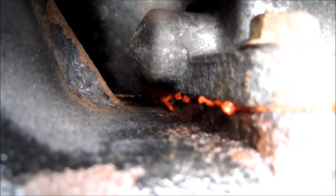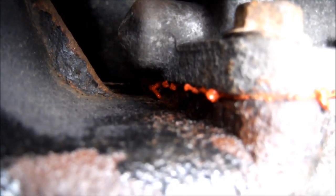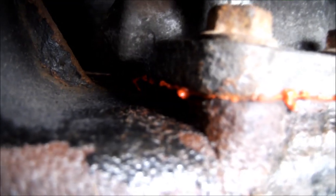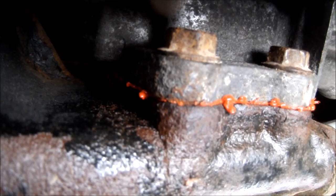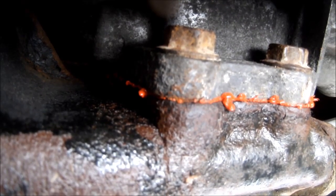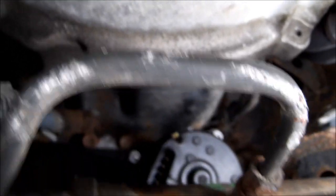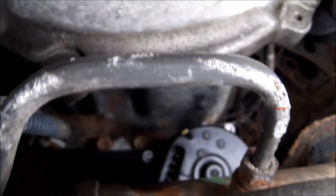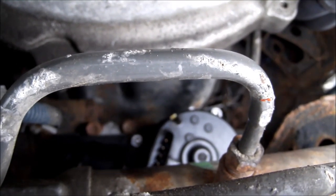I don't anticipate this leaking. I don't think it's super high pressure inside a differential, especially since it's got an atmospheric vent. And then I'll go back to the top and snug those down the rest of the way, and then the bottom two, and I'm done with those bolts. I got the clip bolt, or the Allen head bolt, in there with the clip on it for the wire. And you see all the bolts are installed now.